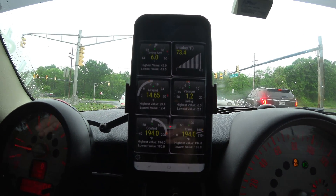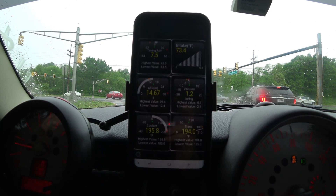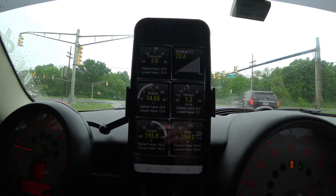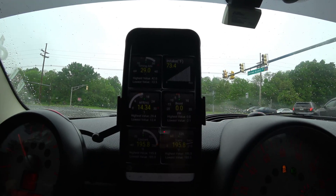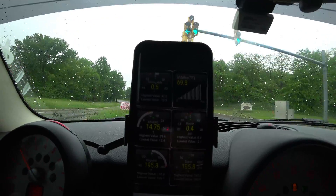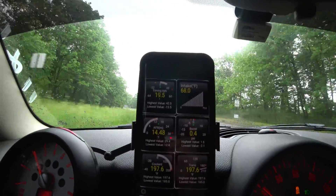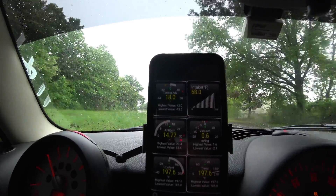So that's basically what I prefer to monitor on a daily basis while I'm driving around. It's also what I keep an eye on when I'm at the track. These are really important values — you want to make sure that you're not getting any knock up there in the timing section, especially at wide open throttle. Now my car specifically in sport mode, when it's doing those pops and bangs, it will pull timing when I let go of the throttle. You can see that it went to like negative 13.5.